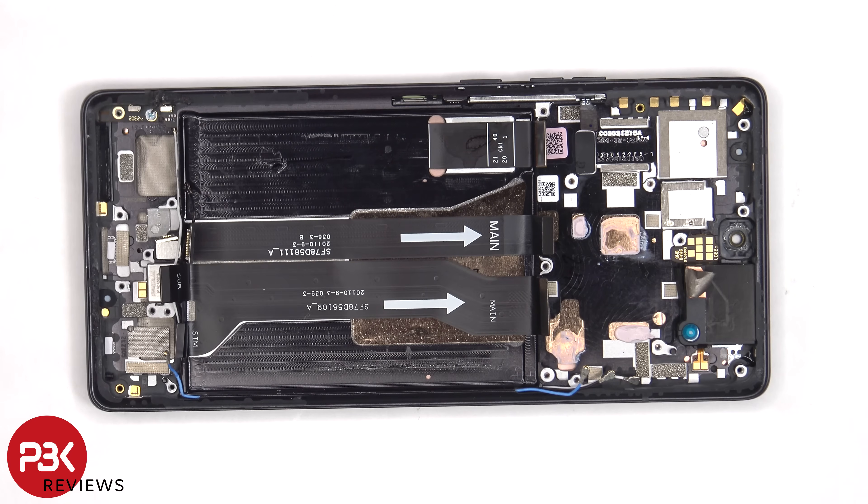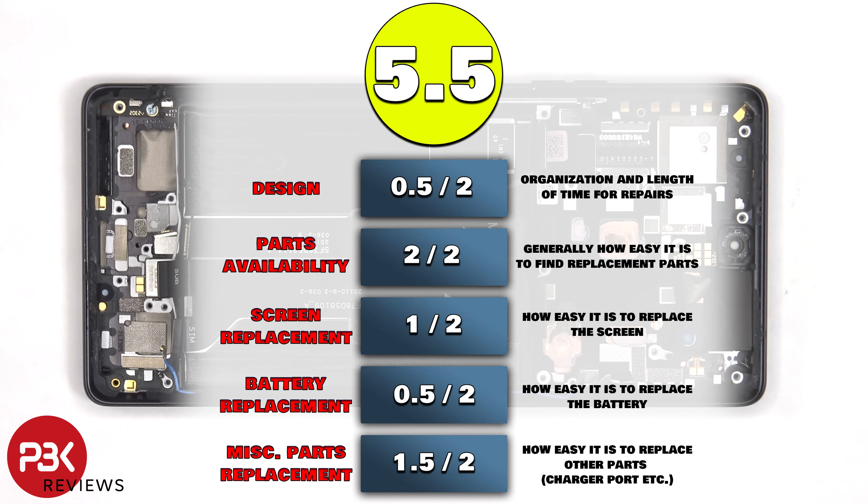There is yet another microphone on this side of the frame which is attached to the flex cable for the volume keys and power button. So if you need to replace either of those, you'd have to gently pull out this metal bracket which is seated inside the frame. The proximity sensor board is located here, and it's held on with some adhesive. The earpiece speaker is located on top, which also has the little white foam balls that make it sound larger than it actually is. For the repairability score on this phone, I give it a 5.5 out of 10.